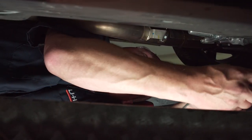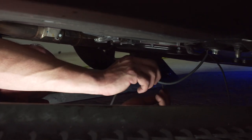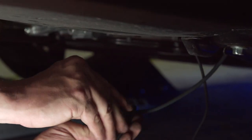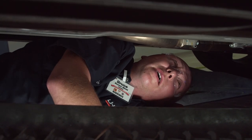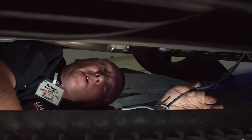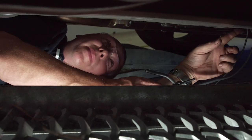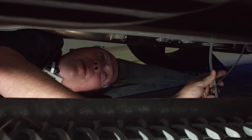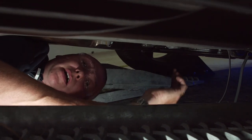I've dropped a little wire that I'll just tie my power wire to. I've run it down the engine compartment where there was a safe spot that also didn't have any hot or moving components. I'm going to run it to — I had actually dropped the wire down the passenger side of the engine compartment — to connect these two together and pull it up in an area that does not have any moving parts or hot exhaust. When I get to the end here I'm going to pull it up to the engine compartment and continue to zip tie it up to the battery area.